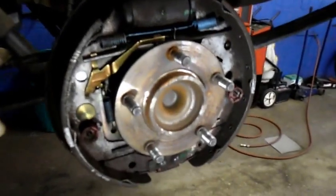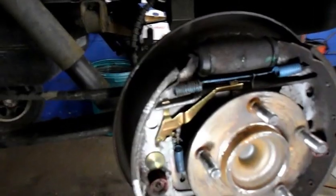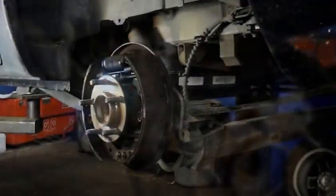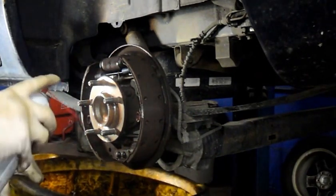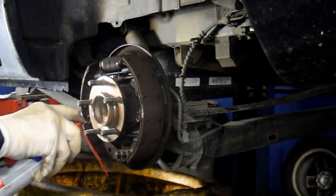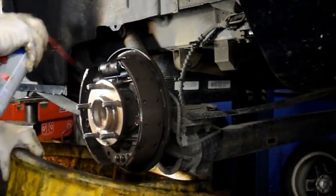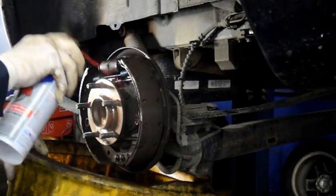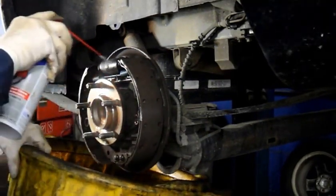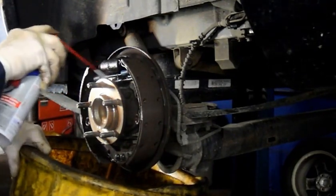So let me call up and get the cables for it. I'm going to change both rear cables because this one is staying applied also. First thing we're going to do is clean off all of this brake dust that's inside here. Get yourself a can of brake cleaner and just spray it very lightly - not too fast, because you want to get all this stuff washed off without breathing it.